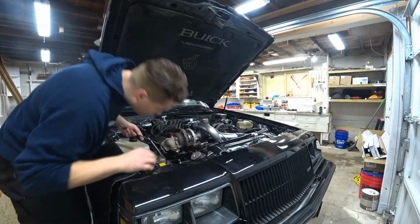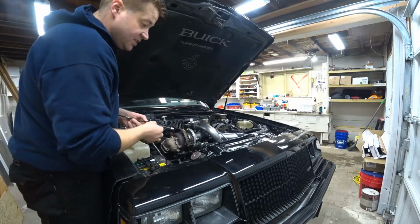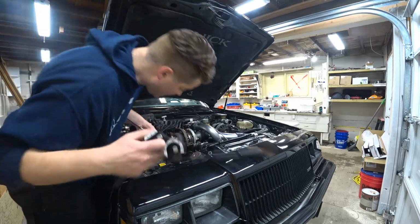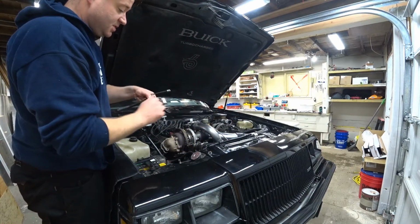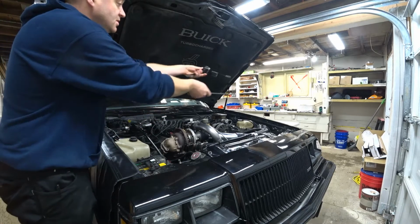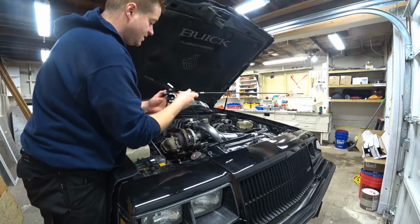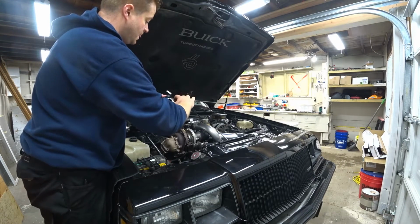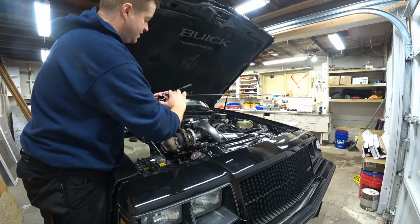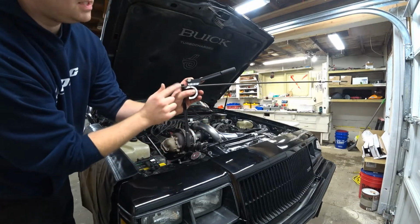And looking in there, it looks like I just need to make about a 90-degree turn heading up north, and pretty tight. It might actually be more of a 90 because it has to be so tight to that thing. So we open this up, take our tube, again get that nut down there, set this on the appropriate size here. I'm going to do this as close as I can to that nut. And then you close this guy. You'll see that the 0 lines up with 0. Okay, see I'm pretty close to that nut.